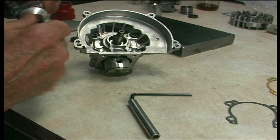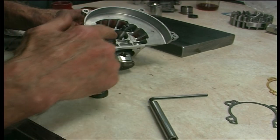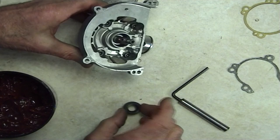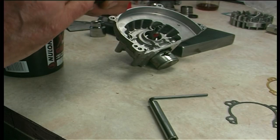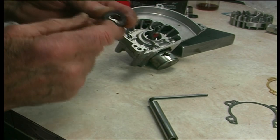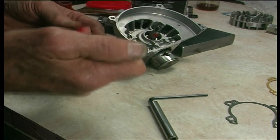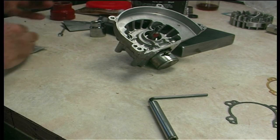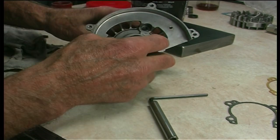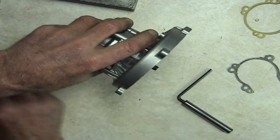The cap back on there. Before we go any further, there's your seal for that end there — it just goes up flush. I usually prefer to use a bit of grease on there. Put a little bit inside your seal here. Sometimes when you get seals for a vehicle, the factory have already put some grease in there to make sure you don't forget. Put a bit more on the inside there — it doesn't matter if it's a bit too much; the grease won't get inside your engine. Try not to force it straight down — just rotate it slowly to avoid cutting it accidentally on your key slot keyway.